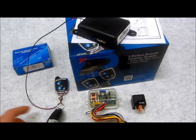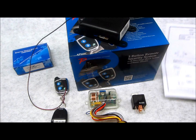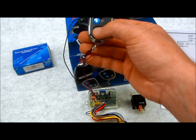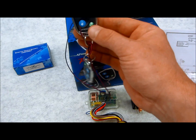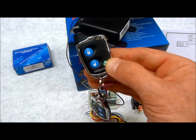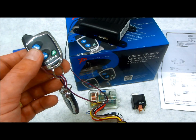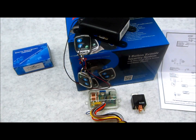Getting on to the problem — I'm going to use this here. It's a basic middle-of-the-road alarm system, nothing fancy. It's an APS 25C, around a 50-60 dollar alarm system that comes with two remote controls. For this guy's use, he can't utilize lock and unlock because those only send a pulse for about 0.5 seconds. However, there's also a channel 2 button, which can be used for trunk release, sunroof, remote start, and similar functions. He just wants a 12-volt system to transmit and hold a signal.